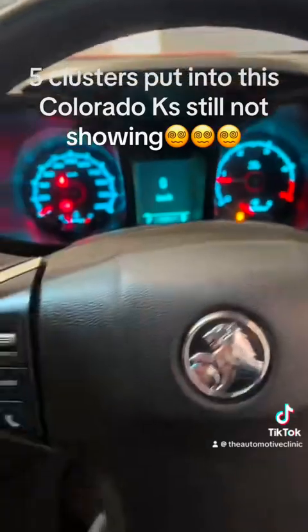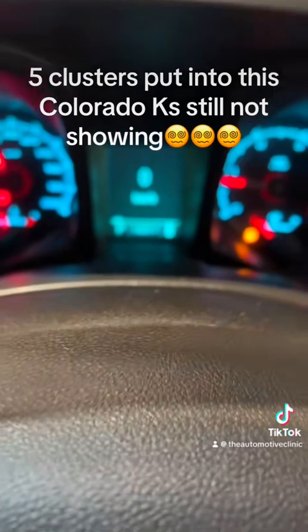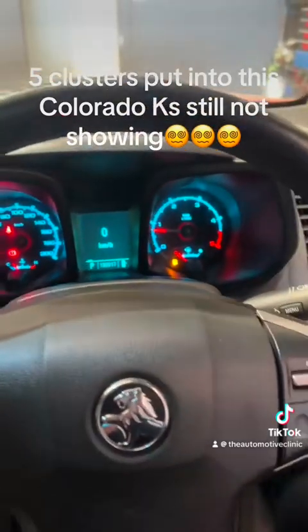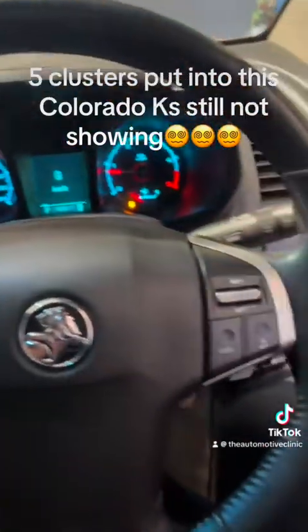A customer purchased this car with it running and driving but no mileage showing — all zeroed out, just lines in the odometer section. This is essentially GM or Holden's indicator for a VIN mismatch or programming mismatch between the gauge cluster and BCM.